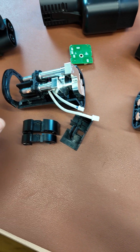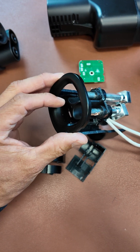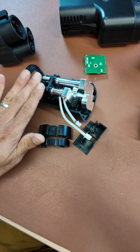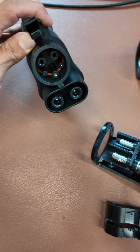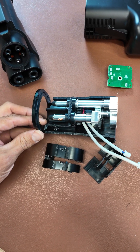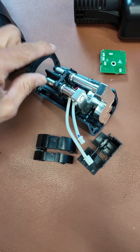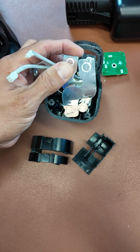This is possible because modern Teslas and all the new vehicles that are going to have this connector on them are all using the exact same communications protocol that CCS uses. And that is not the same protocol that we find in older Teslas — they use a CAN bus protocol more similar to what we found in CHAdeMO vehicles. Also worth noting, the DC pins are swapped as far as their polarity on an NACS inlet versus a CCS inlet.